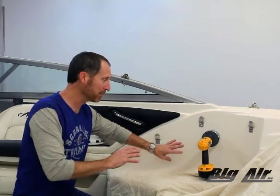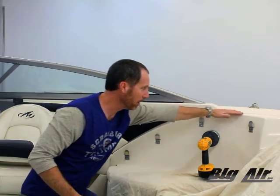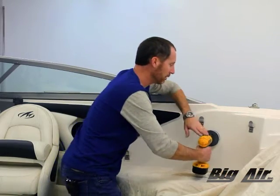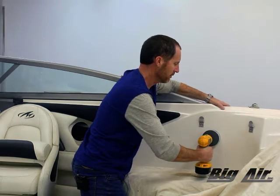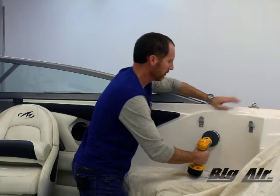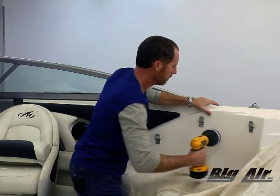This is fiberglass — we're going to be just fine. My actual mount is out here approximately right where my hand is. I'm in line here, I'm below where my interior panel goes, avoiding my hooks and latch pieces. I'm ready to pop a hole in this. Watch how easy it is. I've started my hole — it shouldn't take long. There you go. Beautiful.